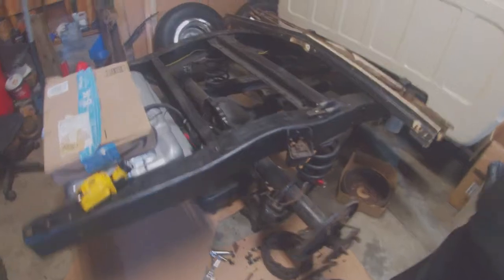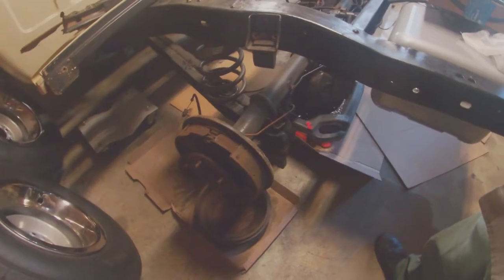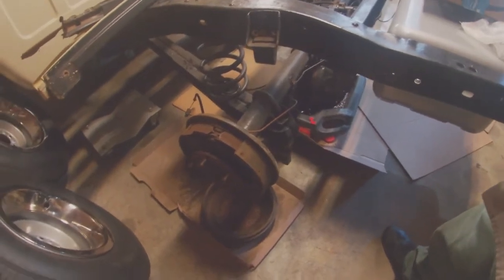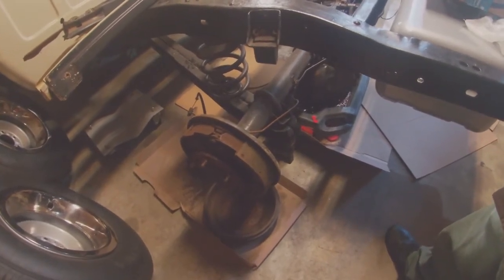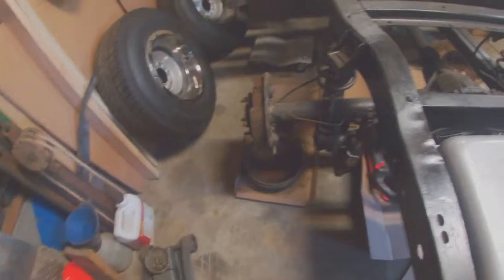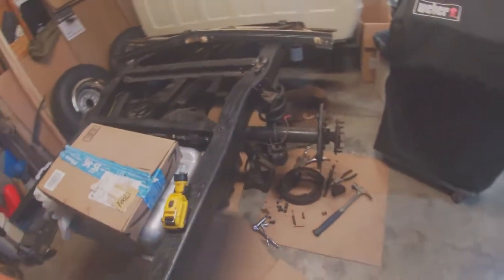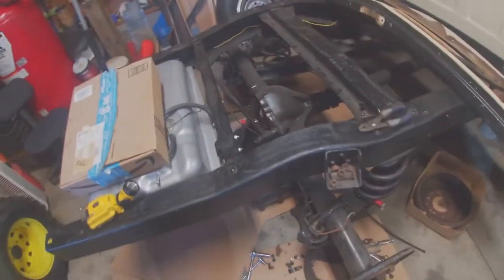But I want to bring you up to speed on that. Where we're at on the 68, we're going to disassemble it this weekend. May make a short video on the disassembly process and rebuild, make a video of the whole thing. We're going to basically put new bearings and seals, new brake pads, new brake lines. I'm going to do all of it with the rear end in there, because I really don't want to have to pull it out from under the truck, unless I find something bad once I get in there that's beyond just simple bearings and stuff to get fixed.